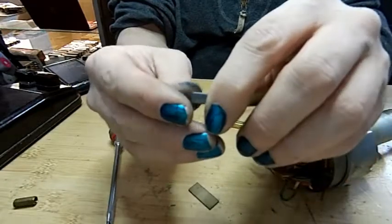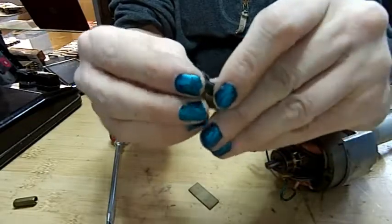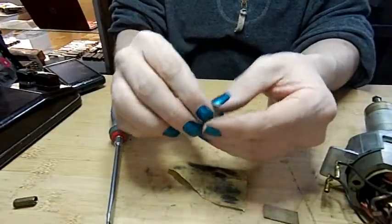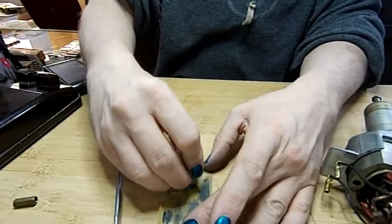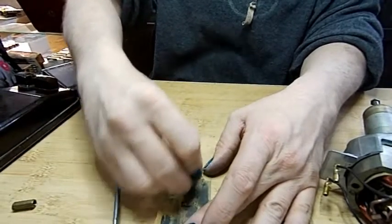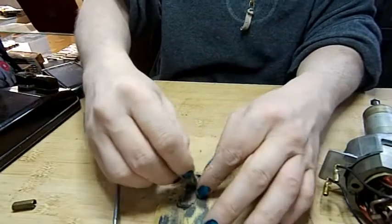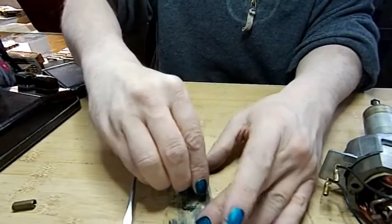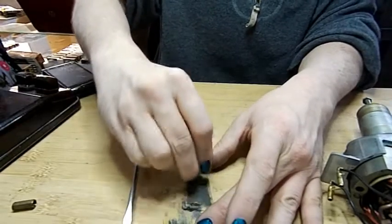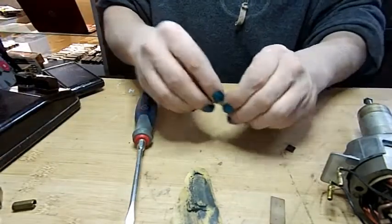You want to inspect your brushes. These are in pretty good shape — they're not worn down hardly at all. We are going to flatten them. The way I flatten them is I take some 600-grit sandpaper, leave it in this brass or copper housing, and run it flatly across. Some of you may say you don't need to do that — you don't have to, it will wear in and curve again. But you seem to gain just a little bit of pep if you do this. Plus, new ones are flat for a reason. This will give them a chance to re-break in, because we are going to polish these commutators.